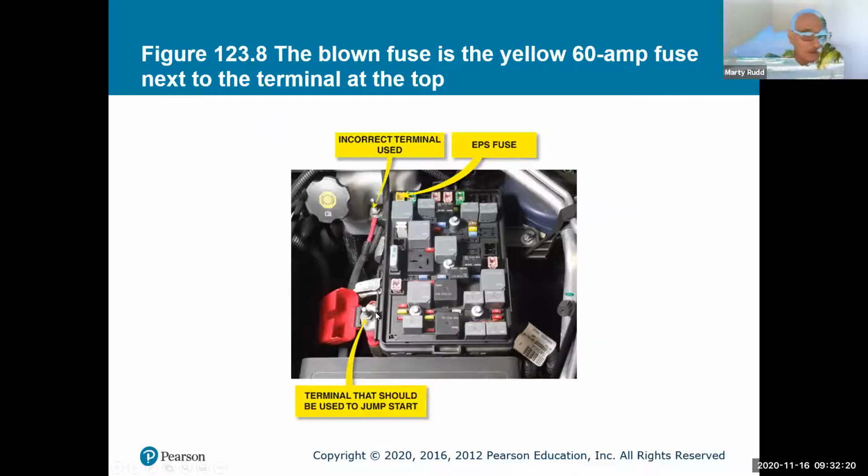But you'll see the connections. One of the things I always look at, whenever I have a fault, is I look for blown fuses. And if it doesn't work, then I'm looking for why doesn't it work? Is it not getting power to it? This is one of the things that we do. We look to see, is it a blown fuse, is it a bad relay? And then after that, we start going down the different steps that the manufacturer asks you to do.